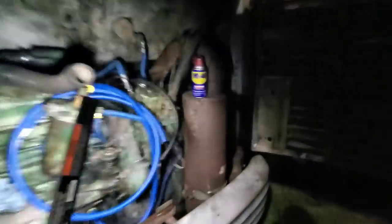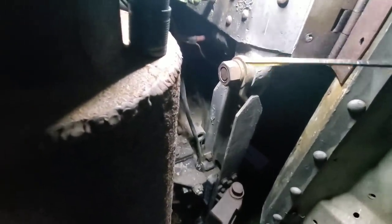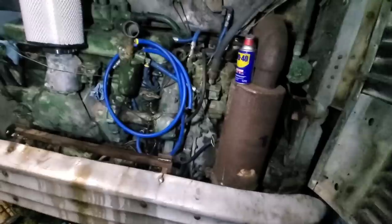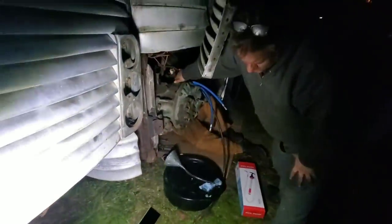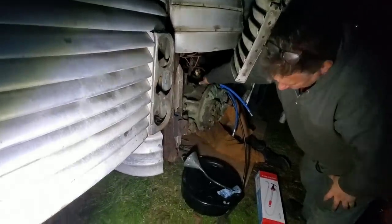The transmission fluid — I've been filling that up. Let me reach back and get the dipstick out. It is just right at the cold level mark, and it definitely is cold out, so the transmission is good. We'll probably check that after the first test drive. We need to start it up so we can check oil in the morning — check the oil dipstick though, we probably got to put like a gallon and a half more in before we start it. It's kind of a pain to get to on this bus.